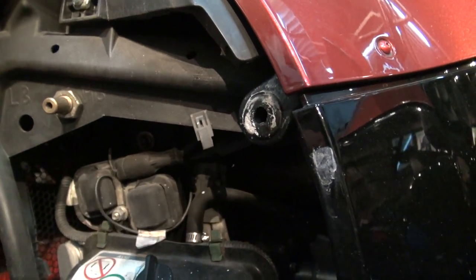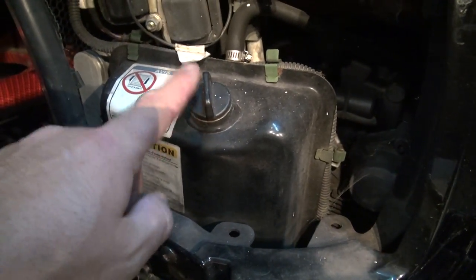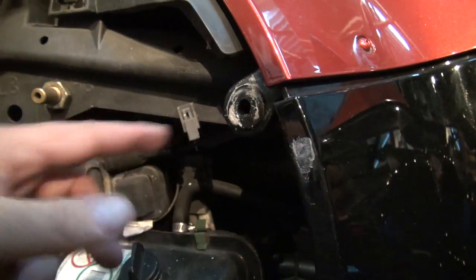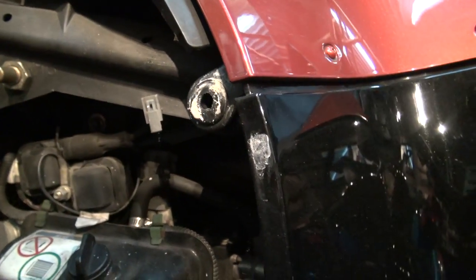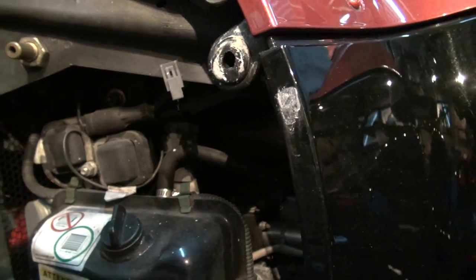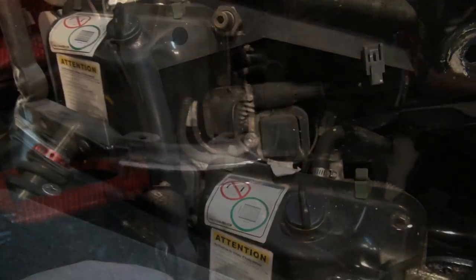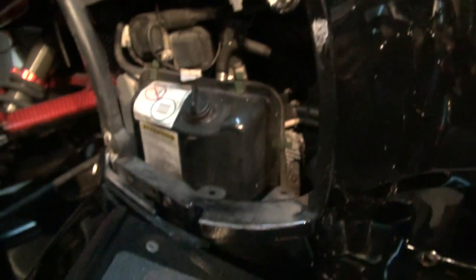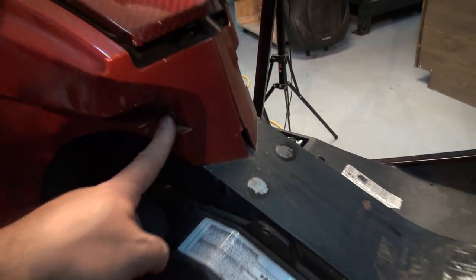These are the three holes I was talking about. I've put a little bit of white grease on these as I remove them often — yes, you do check your oil right here. When you remove these and put them back, you'll notice that with time, especially on a 2010 to 2013, these plastic or rubber pieces tend to want to split open and dry up. I just put a little bit of white grease there — it's never enough for the panel to come off, but just enough to keep it moist and keep it from cracking. We're going to be taking out two other screws now — this is the part where the oil changes. Right underneath here, we're going to be removing that one — that's Torx 30 — and also this one right here in the center.